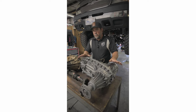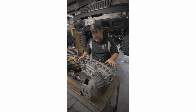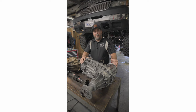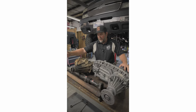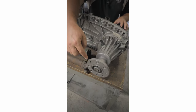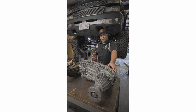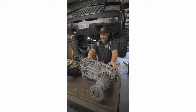So instead of fixing the 263, we're doing the 273 swap. The 273 is also a New Process transfer case. It comes in Ford F-250s, F-350s, F-450s, and also some Dodge trucks, though the Dodge version is a little different. We buy this transfer case from Transfer Case Express as a GM swap. The key difference is that the 263 has a slip yoke in the rear, which can drip fluid and cause leaks. The 273 has a fixed yoke and flat flange, so you can run 1480, 1410, 1350, or CV driveline options. Whenever you have the chance and the funds, the 273 or 271 swap from Transfer Case Express is the way to go with our solid axle kit.